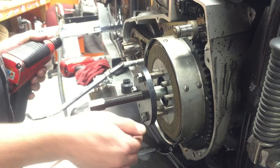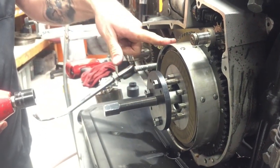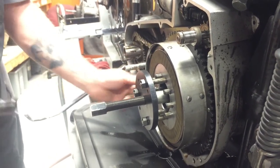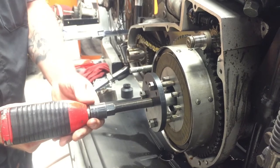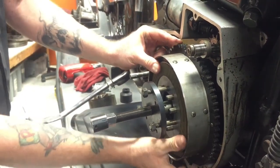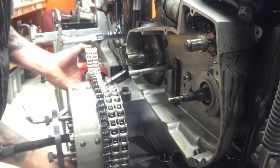Once you have the tools installed, tighten up the nuts, tighten up your shaft. The clutch hub on shovel heads is on a taper so you have to pop them off. Make sure you've undone your compensating sprocket and your primary chain adjusting bolt. When it pops off, you can just pull it right off the shaft like so.